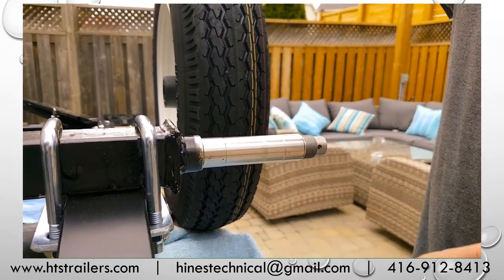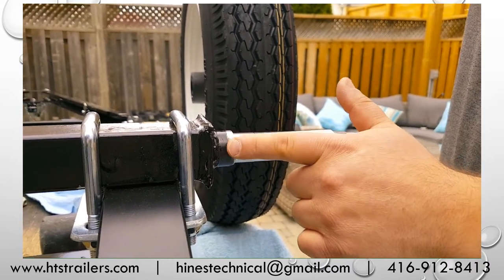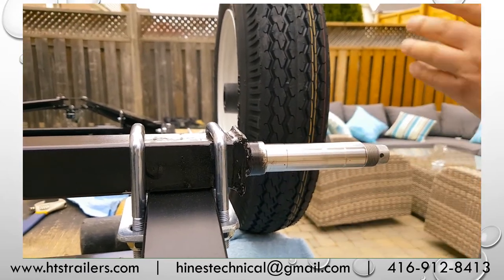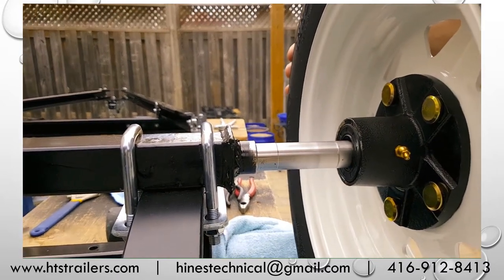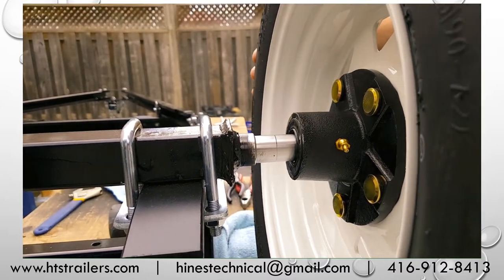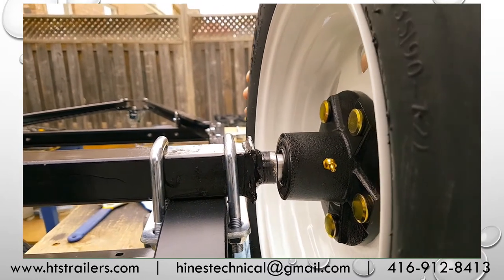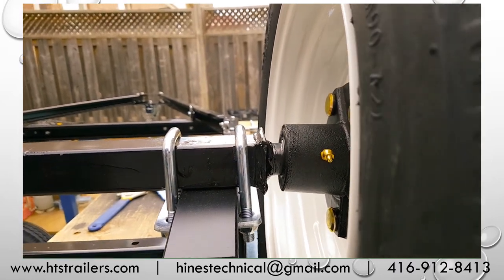We've got it nice and cleaned. As I'm assembling this, I want you to pay particular attention to this area. You're going to see the seal take that raised shoulder part, and you should see me push the wheel and the hub up right against that shoulder, and that's basically what I'm looking for. But here we go. You want to carefully align this and be very sure that you're not damaging your seal. And as we square up the axle shaft onto our bearing, it begins to slide nice and easy, and here we go. Now we're actually close to our shoulder, and what I'm going to do is start to press against this. And I'm just rotating the wheel ever so slightly. Every now and then you get a stubborn one, and there you go. You see how the seal now rides right over top of that raised section.